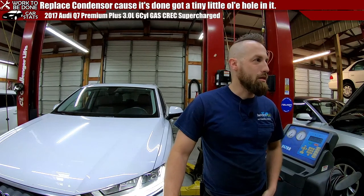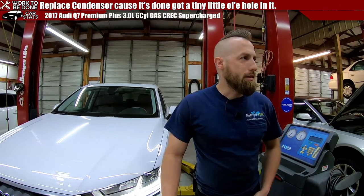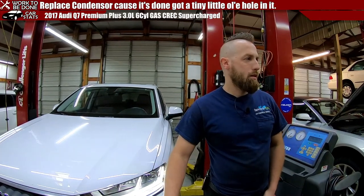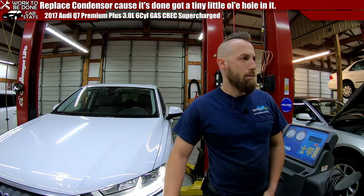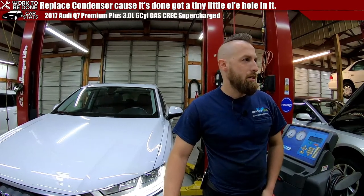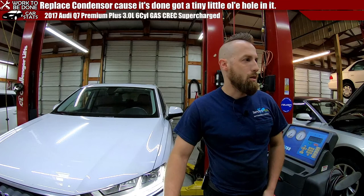I'm just gonna do an auto scan. Gateway installation list. How much crap we got with codes in it from stuff I've unplugged? No, not that much. It's only 4. Auto distribution. What's the code there? Just data bus. That's probably just a regular code it has all the time. Lane change. That might be a little affected because we pulled off some sensors. Nope. Data bus received error message. Fault slave. Intermittent. Whatever. It's cool.